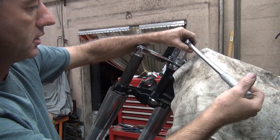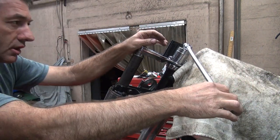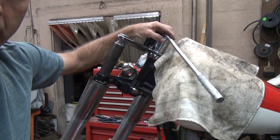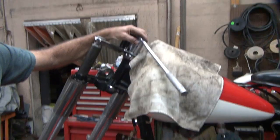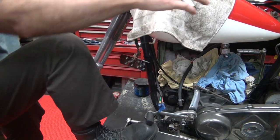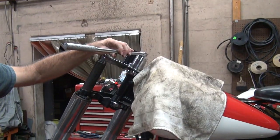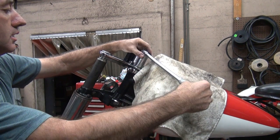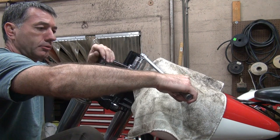If you tighten the nut up, it rebends the tree back to fit. Okay, now I get some torque on this. I said kick the camera. I've done that before and flipped it. So we got to put our foot down here against this, like that. And you put the hand up here and you go yank on it. Up there, you get a little leverage. And you notice I got the fork against the stop, so I don't have to fight that. Okay, here's the appropriate torque.